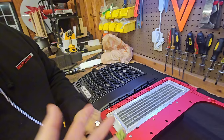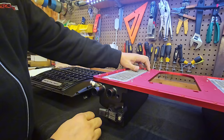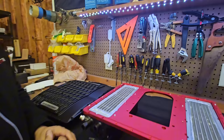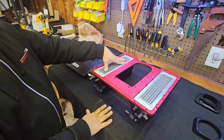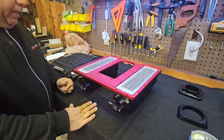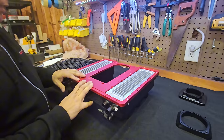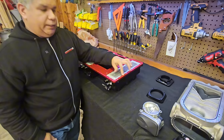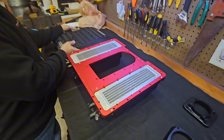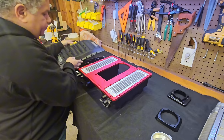To secure the core — it's super easy. There are three bolts in the front that pull the core forward; you always want to do those first, then work in sequence from center to outside. No gasket is needed underneath — there's enough surface area and tightness that the air will find its way where it needs to go, which is through the core. There's also an O-ring groove pre-installed around the entire edge that seals the top hat — when the top goes on it just seals it up for you.